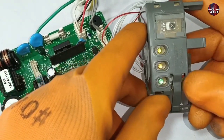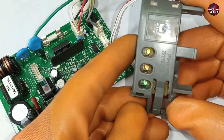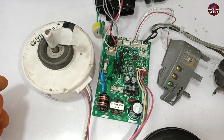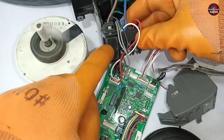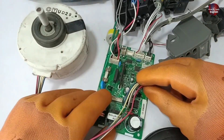But as I switched on the emergency switch on the display while troubleshooting the fault, the circuit board turned on. You can see two lights are now blinking on its display — sensors are not installed, which is why it is showing this error. I have attached the blower motor with it, and it has started to work with the remote as well. The blower motor has also started. Now I am waiting for the output — the switching relay will turn on, then pass electricity to the output terminal. The relay has switched on.